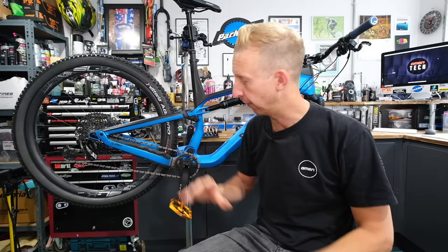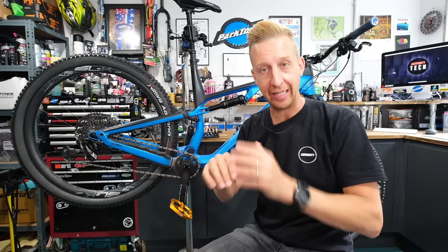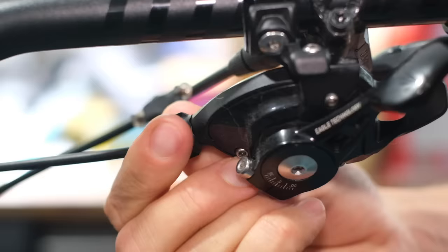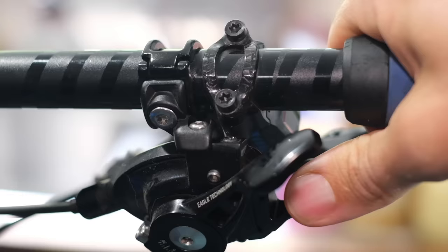Let's have a system reset to make sure everything is ready before making any adjustments. Go up to the shifter first — this is the barrel adjuster. Its job is to take up any slack in the system. You can sometimes hear this referred to as cable stretch, but it's not technically cable stretch because the metal cable doesn't stretch. You do get slack as the outer housing and sheaths can bed into place. Screw it back into the shifter, basically giving it more slack. You might find the outer housing moves around a bit — just double-check and make sure everything feels smooth.